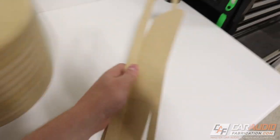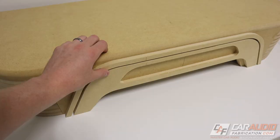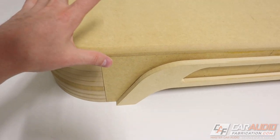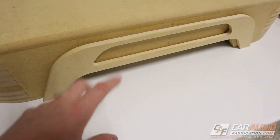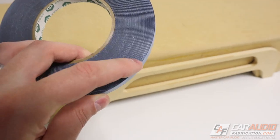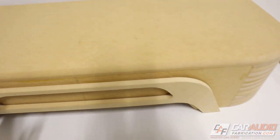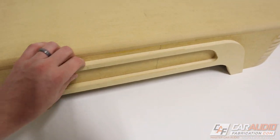I'm going to remove some of these other pieces. For now I want to focus on these two starting pieces that are going to attach to the front of the enclosure. When you're adding an insert onto an enclosure you want to form it into the box to transition — in my case between carpet and vinyl — and you want somewhere for that material to tuck into a gap. The first way you can do that is make the shape and apply a foam tape about 1/16th of an inch thick to the edge. You secure this to the enclosure, take body filler and smooth it out, sand it once dry, then pop this off — removing the tape gives you a nice precise gap between the two layers.